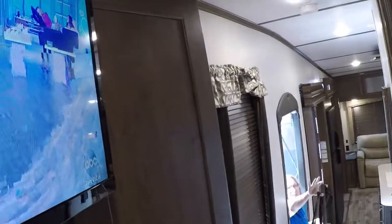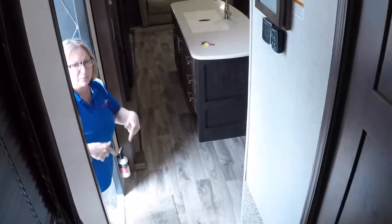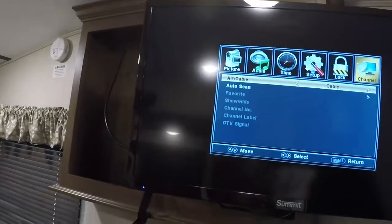We're in the bedroom. There's a bag with some coffee mugs. See this little green light? There's a little button next to it — if I hit that button and turn it off, it'll hinder your reception. So this needs to be on if you want to watch antenna. Now, if you happen to get a campsite with cable and you hook the trailer up to cable, this needs to be off because it shares the same line coming in and it'll interfere with the cable connection. The only other thing you'd have to do is hit menu on the TV remote, go over to channel, switch it from air to cable, and do your auto scan — it would find all the local campground cable channels. A lot of campgrounds have gotten away from having cable hookups though, so it's kind of a rarity nowadays.